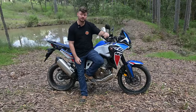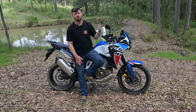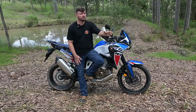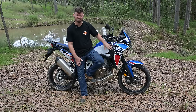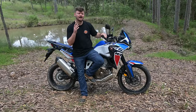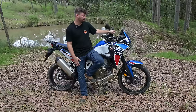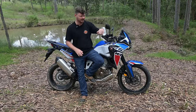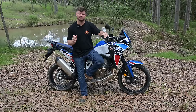We're into the nitty-gritty — would I buy the Honda Africa Twin? Unfortunately I'm in the no camp. The ABS alone is a deal breaker for me. I do a lot of off-road riding and it's frankly dangerous. Then there's the air filter access — I do a lot of off-road riding so I'd be checking it regularly, and I don't have enough time to go riding as it is, let alone take half the bike apart. The dash is fiddly to use, and while I love the Android Auto, it disconnects when riding off-road and I can't even connect my earbuds. All those things add up. That's sad because I do like how the bike feels overall — I like how it's just a big dirt bike.